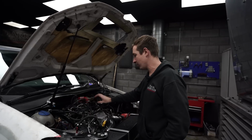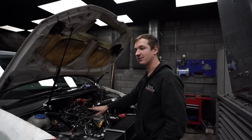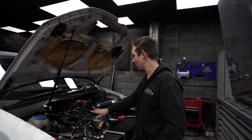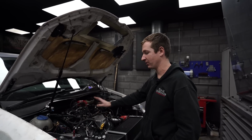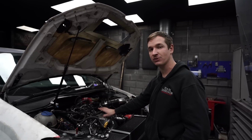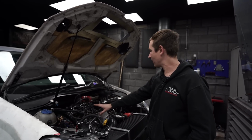We've got the cylinder pressure monitoring glow plugs in here. These are factory cylinder pressure monitoring sensors, the stupidly expensive ones. They all stop working, and hopefully we're going to get them sorted out pretty soon and we can actually see what's happening, because once you're at full load, these are maxed out at 220 bar, which is quite a lot. Not many petrol engines will be running 220 bar cylinder pressure, I wouldn't have thought. Definitely not at low RPM anyway.